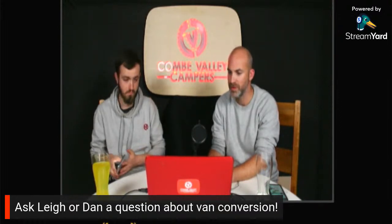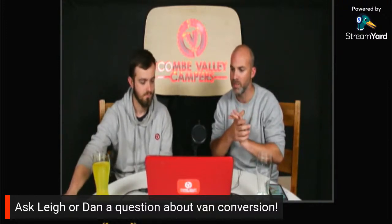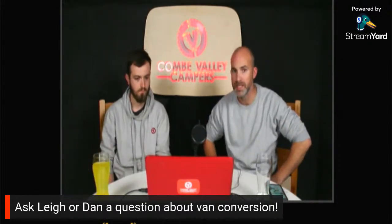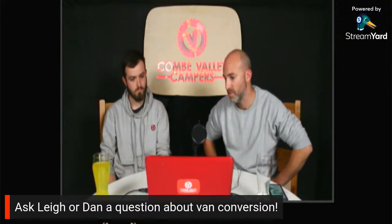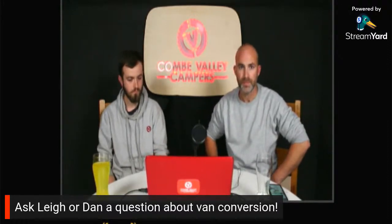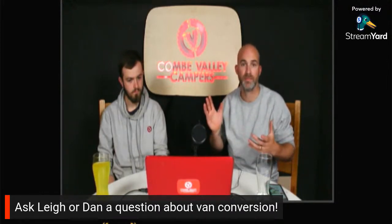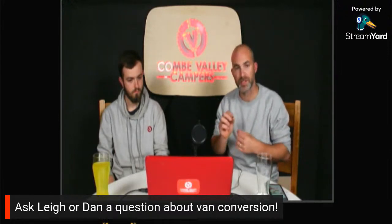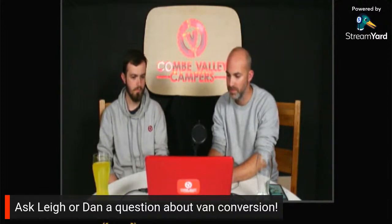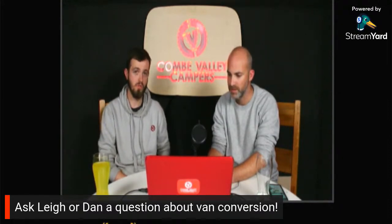The other question we missed was: Ford Transit Custom camper conversion, LED lights and a remote and dimmer. Planning to just cut the wire after the module for a remote and then wire back to electrics. Will that work before I cut the wires? I'm going to say it completely depends on your LED lights, your controllers and your remote. I would suggest doing a bench test first before you install the entire system into your camper van. Maybe just rig up a circuit in your workshop, on your floor, in your garage, whatever it may be, just to test the system works before you permanently install it. You've also got to be careful using the vehicle electrics, because they work on the CAN bus system, or something slightly different, so it doesn't always work as a normal 12-volt cable would.